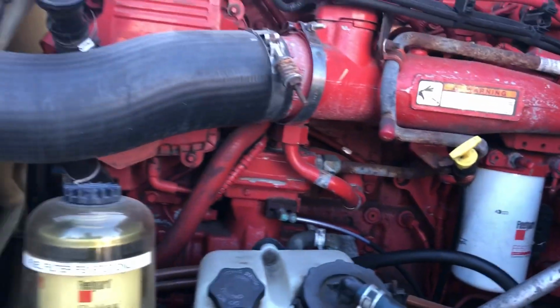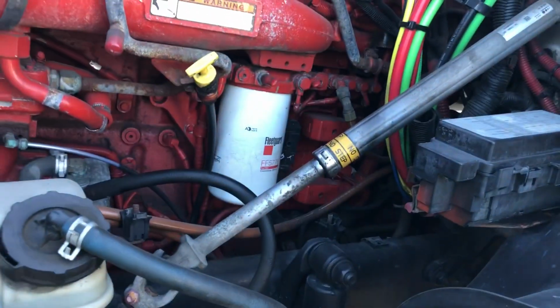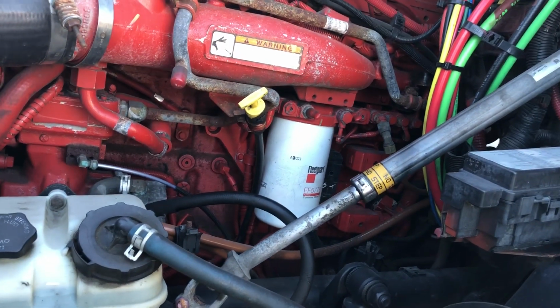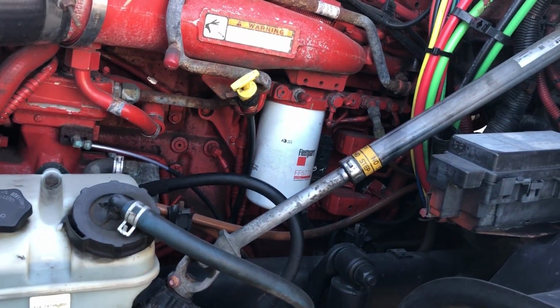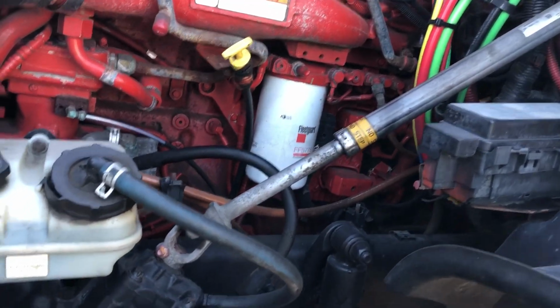All right, we're also going to check our air compressor. We want to make sure that that's gear driven, it's not leaking, it's not cracked, broken, needs to be in good condition as well. Now we're coming to our big three, very important: our tire assembly, our brake assembly, and our suspension assembly. You want to make sure you get these parts and have them memorized very, very well. We're going to start out with our suspension here.